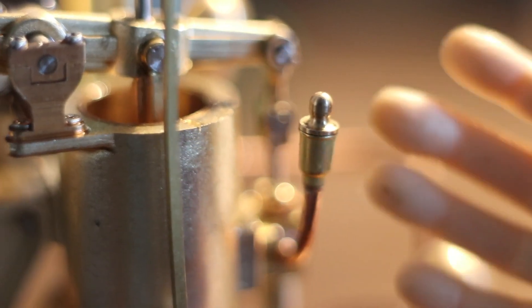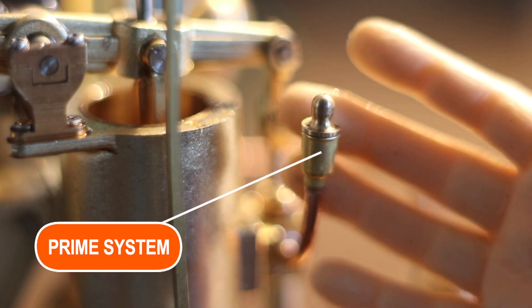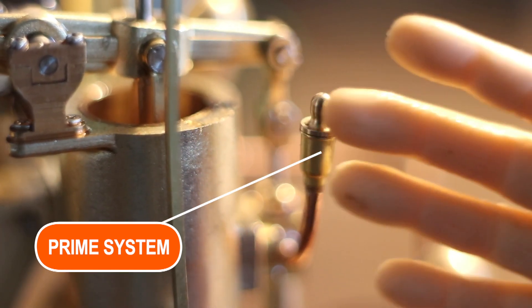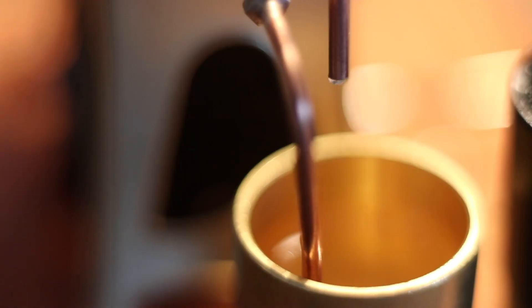Here's a big tip if you get one of these models: the pump has to work and the water jacket has to be filled with water. Fill up the tank and prime it using this little part here with a syringe, and make sure when you turn the engine that it is actually pumping and is full of water. Then light it, give it a spin.